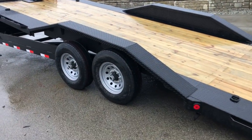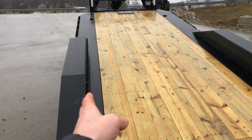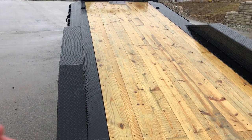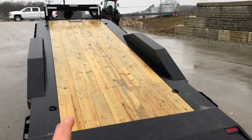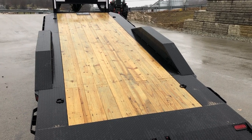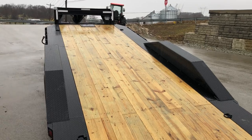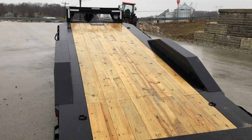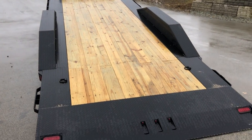These are drive-over fenders, so when I say it's a 102, the tires are going to come out to 102 inches. Basically instead of a traditional 80 to 82-inch trailer, we're bringing the deck out to 102. One benefit is that instead of a deck bed frame that's only going to be about 76 inches, the whole thing is going to tilt — just like a power tilt deck-over with fender boxes, you get full loading width. On this you've got a deck height in the low 20s instead of the low to mid 30s, so there's a lower center of gravity on this particular unit.